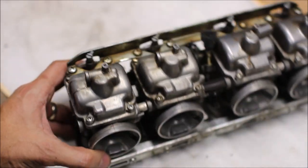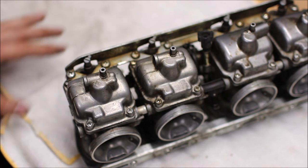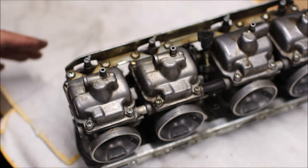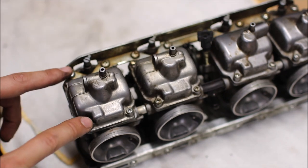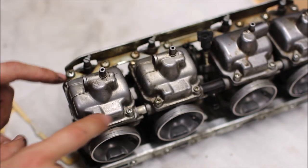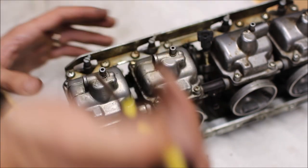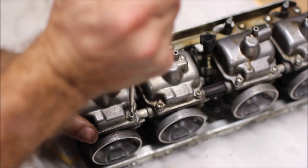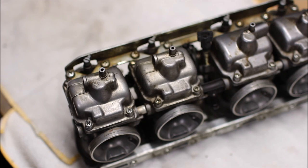When doing this process, it's important to keep the carbs on a nice clean surface, preferably white, so you can see what items fall out and it's easier to retrieve things. One thing I noticed is that these carburetor drain screws are pretty tight and look a little bit rounded. If I just take the screwdriver and try — yeah, it feels like I'm going to be stripping these.